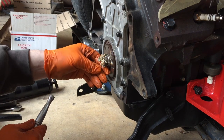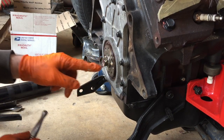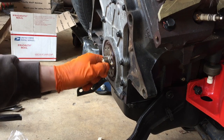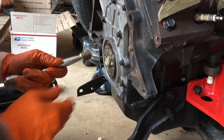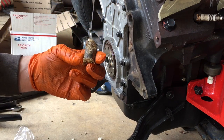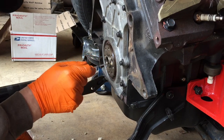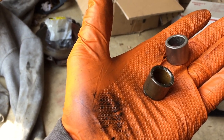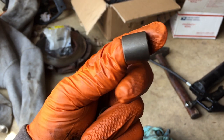Repacking the old bread and grease mixture — just keep packing bread in there. That's what it is right there, your bread and grease pack. It packs in there like that. The new pilot bearing seems to be made of steel whereas the old pilot bearing I took out seems to be made of brass — confirmed it's steel because the magnet sticks to it. We're gonna roll with it and see how it works out.